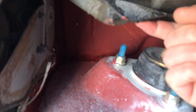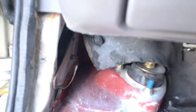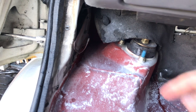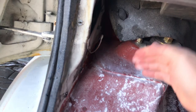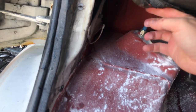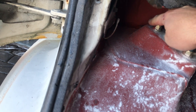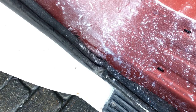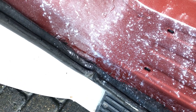Up in this corner here, it's coming in from the bottom of the windscreen, travelling inside the engine bay down the bulkhead, where this arch meets the bulkhead. The water's also coming in from a gap at the back there. We've also got water coming in from the door seal — I think I'll need some new door seals because these are definitely seeing better days.